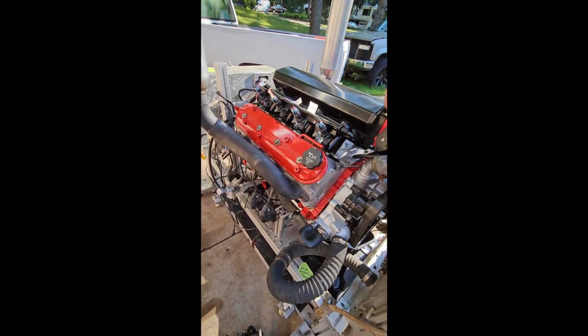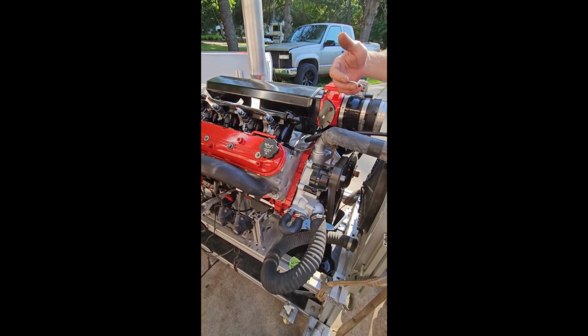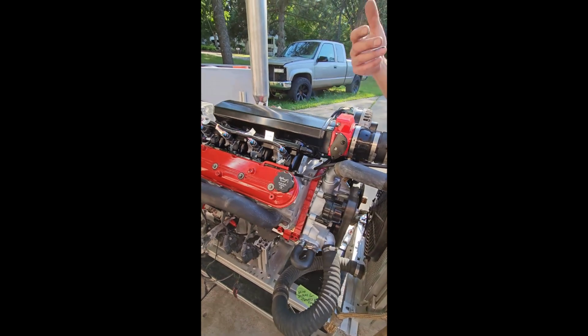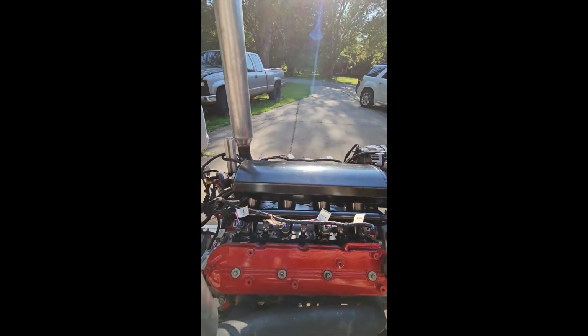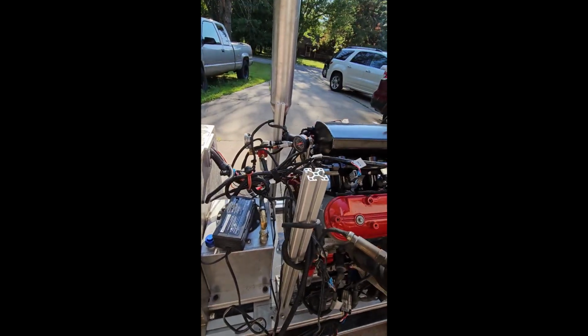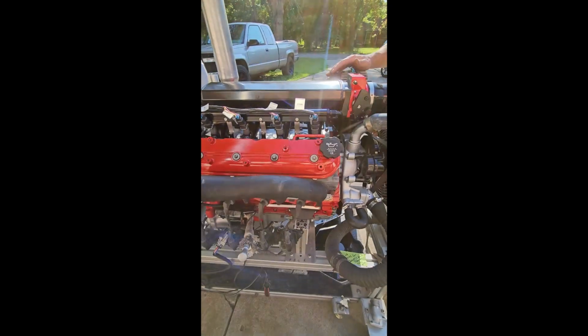And a very common thing with these higher mile motors is the oil pump seal. It's just an O-ring. That's one of the things that makes these fail and lose oil pressure, was just an O-ring that goes on the oil pump. It's all apart. Kind of stupid to not put everything new and freshen it all up.